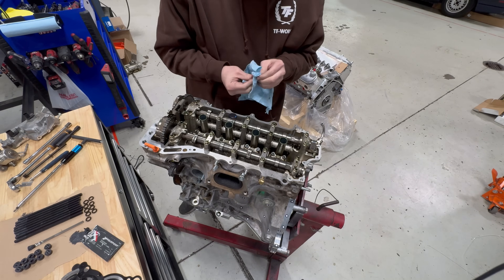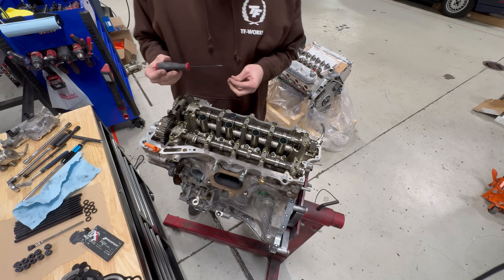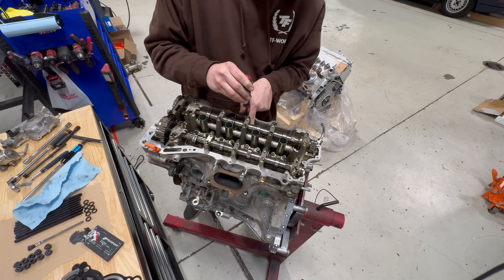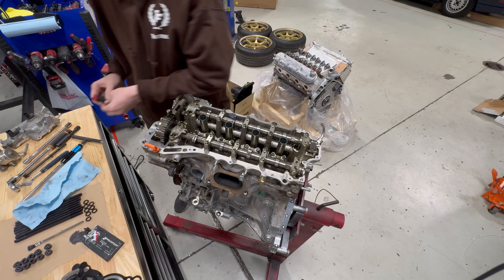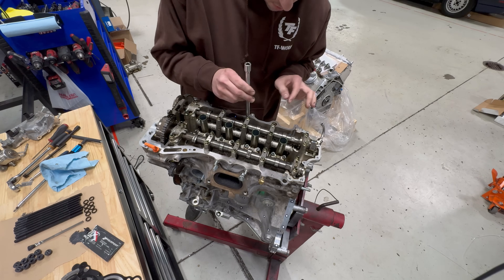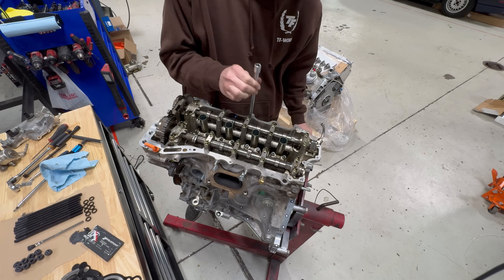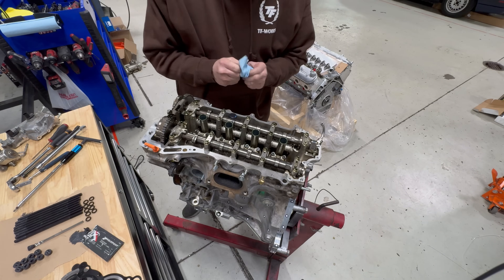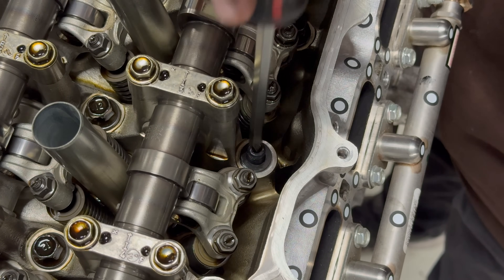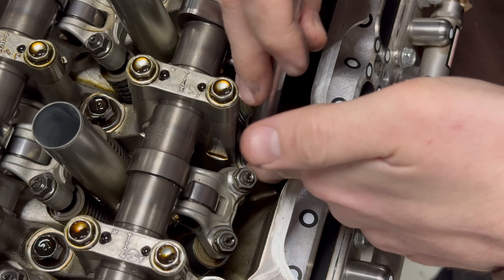The name of the game here is a clean dry washer installed onto the stud. A little trick: take the washer on a screwdriver and drop the washer down onto the stud. The next step is to grab the nut — it's a 12-millimeter 12-point nut — run it down by hand making sure the threads feel good. Do that to all of them, then torque in sequence. Using the screwdriver trick, drop the washer down onto the clean dry surface and install the nut.